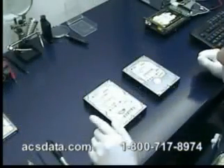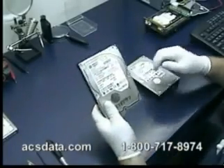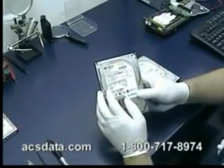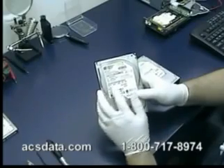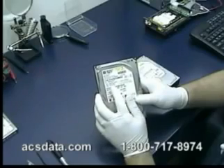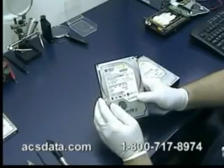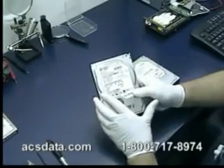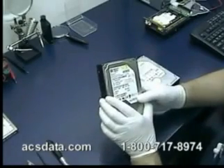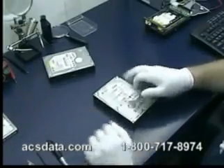So we have our 80 gig hard drive here. We've got it in the clean room and we've got a good parts match. Basically what we need to do when we match parts is we need to get the same model number drive. With Western Digital, some of the older ones, we need to match the DCM as best we can — typically the fourth and fifth alphanumeric characters within that code. With bigger drives you definitely need a complete match. We also try to get them close to the same manufacturing date.